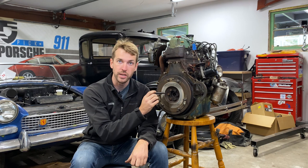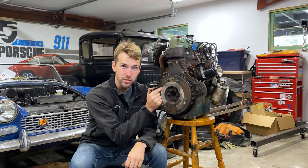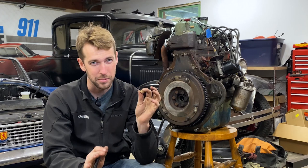The next thing I want to address is here in the back of the crankshaft - that is the pilot bushing, this centered bronze bushing that is pressed into a dimple of the back end of the crankshaft. I want to remove that because a new one of these is cheap - they're like a buck 85. And if they fail, it's a pain. So yet another while-I'm-in-there situation, but it's a small investment worth the money.